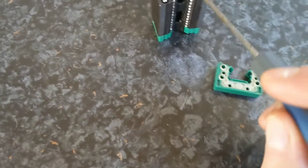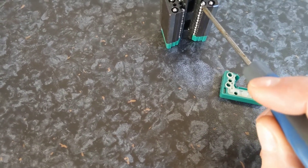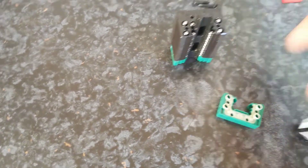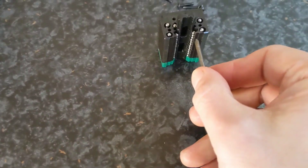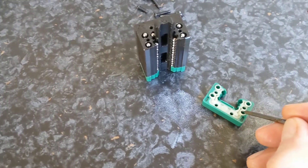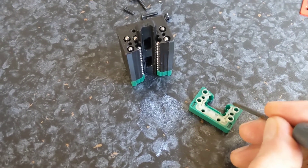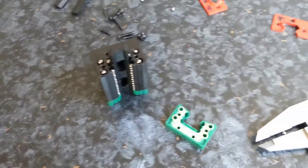There are four races of bearings: top side left and right, and bottom side left and right. They form a ring of bearings that go down and then through a channel inside the block and back up. These holes here are where they recirculate — top side here and here, bottom side here and here.